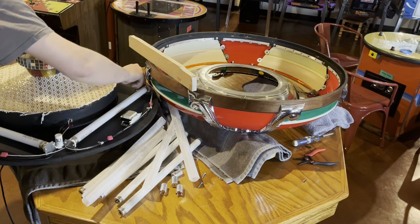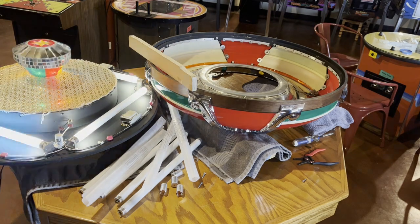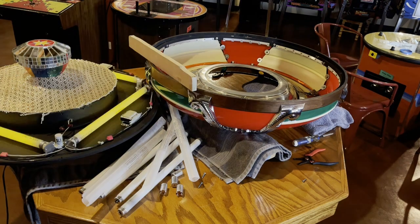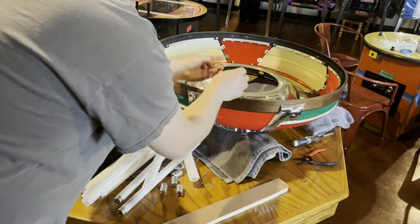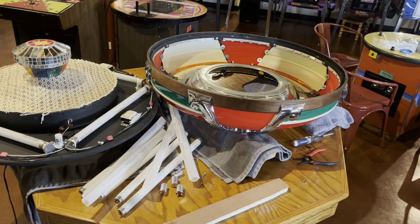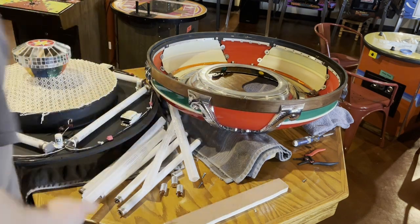Those are your starters — they're responsible for starting the bulb. Before I go any further, this is safe at this point. Don't lift the wires to plug it in. All the lights lit off — I'm happy with that. Now going to reverse the process: put it back upside down, plug in these two connectors, make sure nothing got damaged. Plug these two connectors in and then put the screws on. That's pretty much it — the whole trick is just knowing what screws to take out, and when you put it back on, make sure you line up the holes with the screws.